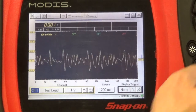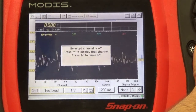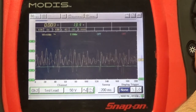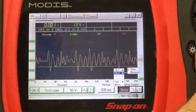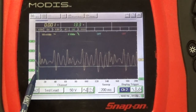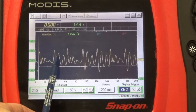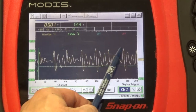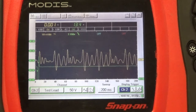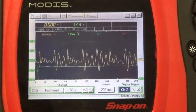So now I'm gonna get my channel 2. Okay, so now I'm triggering off channel number 2, which is my number 1 fuel injector. Now we can see there is a peak over here when the injector fires. We can see here 1, 2, 3, 4, 5, 6, 7, 8, and at this point we can get some information from this. I can unplug one of the injectors and see what's going to happen to this signal here.